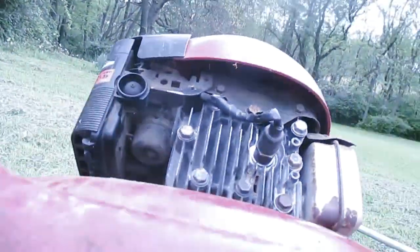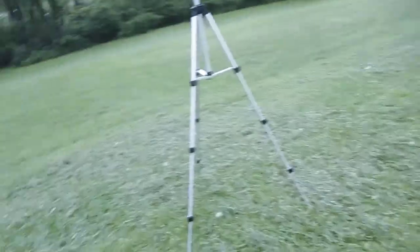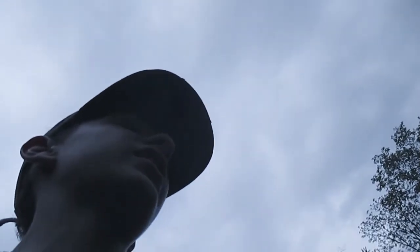So, yeah. One thing that you never want to do, or if you have to do, you don't want to do much, is put the lawnmower on its side. Especially on a side that the carburetor's on, because it'll flood the engine and you'll never get it started. You can get it started, but it's not going to really run well for a little while. It's like cranking the idle on it up to 4,000 RPM a second. I really can't think of much of anything else.